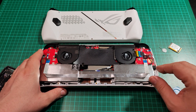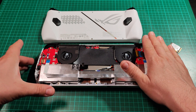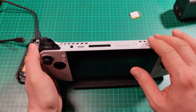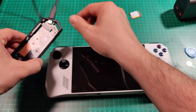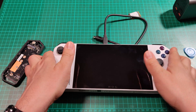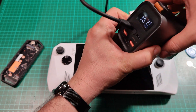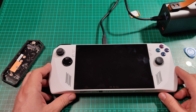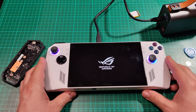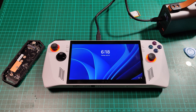This is not going to start because it has a light sensor that knows whether it's open or not. You can either cover this area with something to test it, or put the cover back to see if it works. Here's another tip: your device might not start when you press the button and it's not going to do anything. So just take a USB cable and connect this to the power supply or to the original charger — I'm going to use a power bank for this demonstration. Allow it a few moments to take some power in, and that's going to turn it back on. And now I should be able to start it up — and there you go. Let's see what happens now. And as simple as that, it's back in Windows.